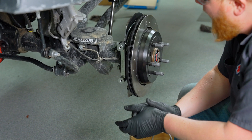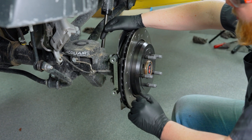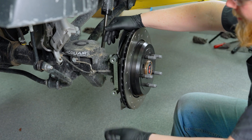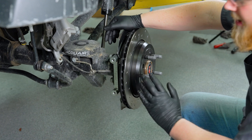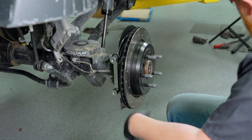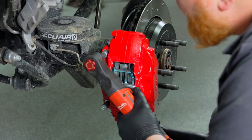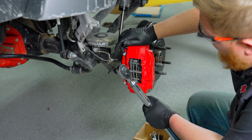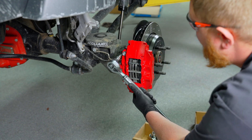The bracket is back bolted on and torqued. To trim the shield, I grabbed tin snips and trimmed the ears away, then also had to trim the inside using the Milwaukee hacksaw — ran the blade along and got it trimmed, then deburred everything. Now we're ready to put the rotor and caliper back on. The reason I didn't pull the brake shield off the Jeep to trim it is because pulling it requires removing the axle shafts, which means draining the diff fluid — counterintuitive since it doesn't have many miles on it. You can definitely trim these right on the Jeep.